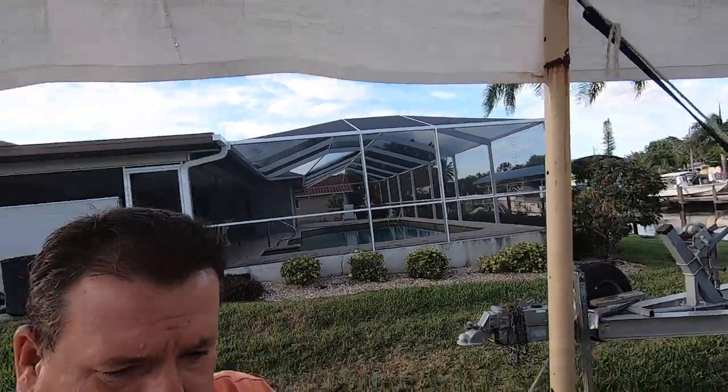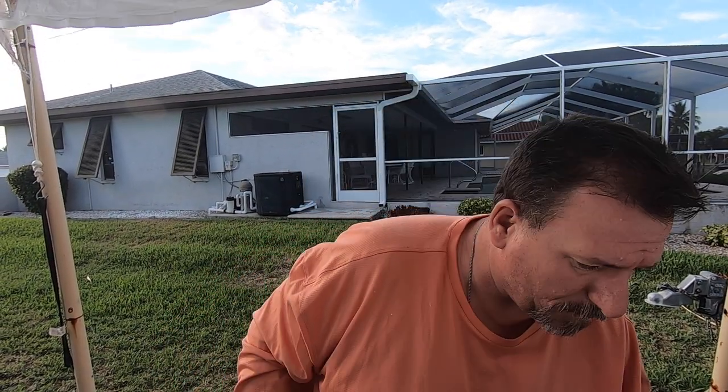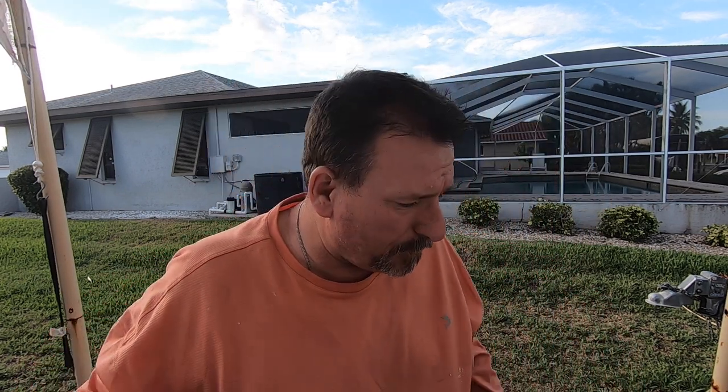What those lines are from is, as we were putting the first coat and second coat down, we were tipping it with a brush. So we tipped it, and then the next layer we put on, we tipped it in the opposite way. So what we were doing is really making a checkerboard on top of a checkerboard. So it was creating a thickness about equal to the depth of the brush strokes, which was fine because I was building up some gel coat on here.